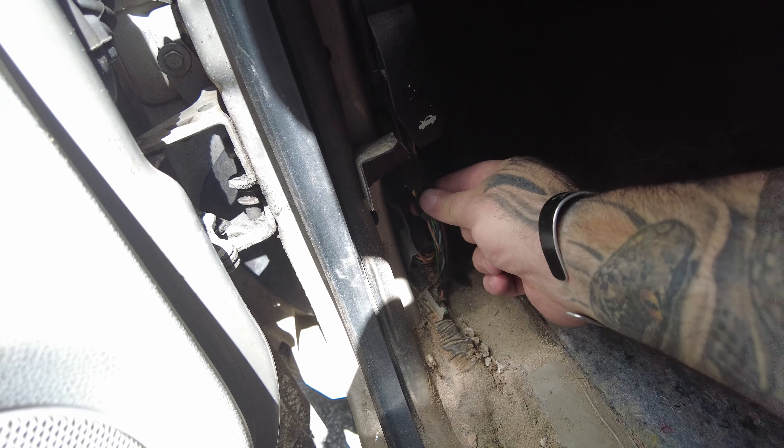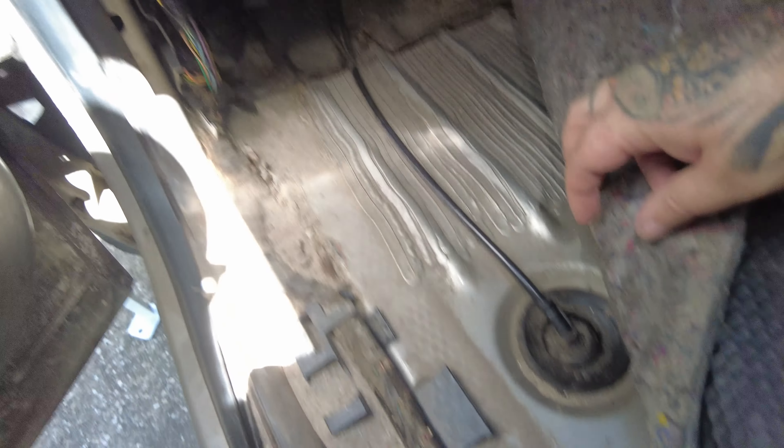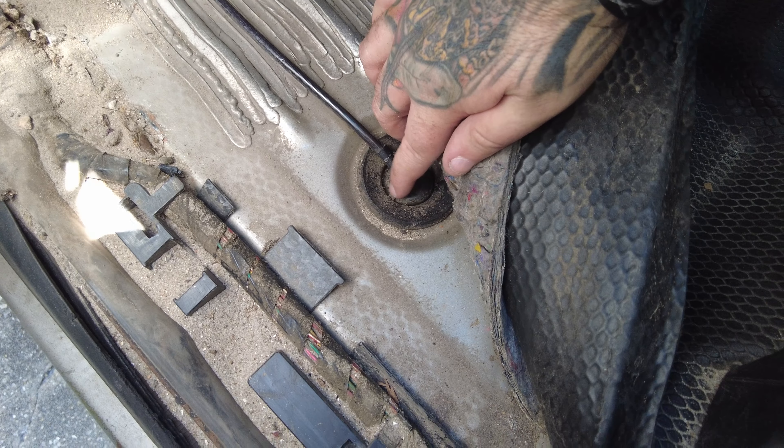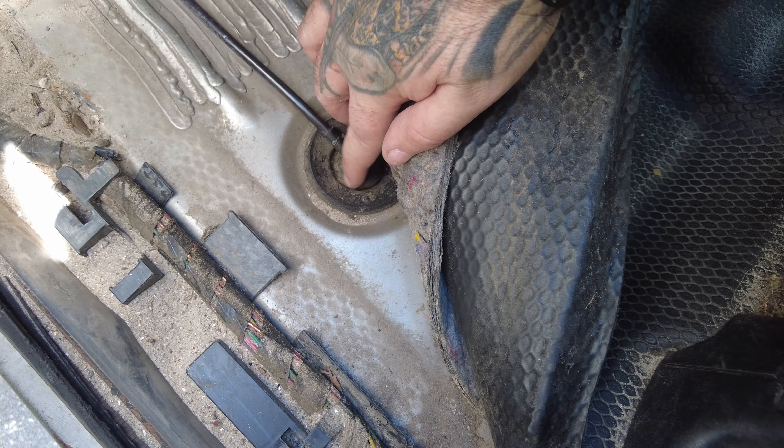I got the panels off — boy, do I need to get this vacuumed out. I'll do it some other time; one of my big goals in this truck revamp is to really get this thing cleaned up. Anyway, the panels are off now. You can see the wiring here which we're going into, and this exposes where the hole is. You can see this grommet from the bottom too. I poked the hole through here, we'll probably seal it up with some silicone, and then we'll run it up through here underneath the dash and across to the radio.